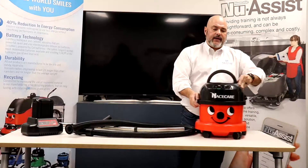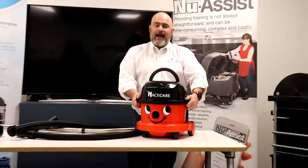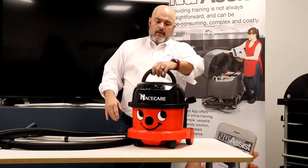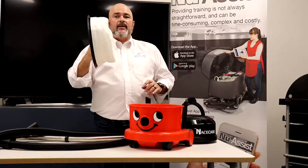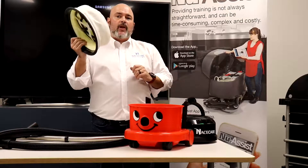Vacuum-wise, if you're still getting issues even though your battery's in and you hear the motor but nothing's being picked up, take the lid off and remove your filter — which is also a daily maintenance task. Make sure you can always see light through it. If needed, give it a vacuuming. Do not throw them in the laundry.